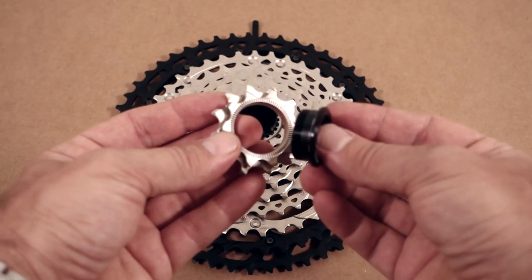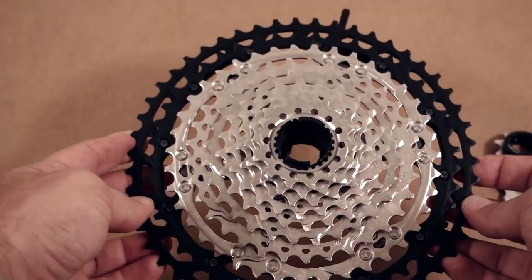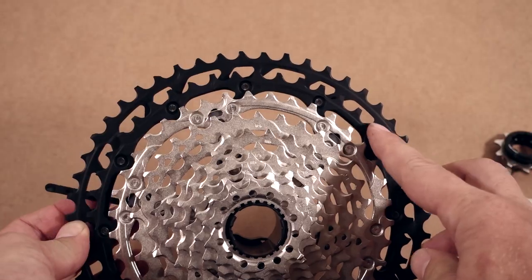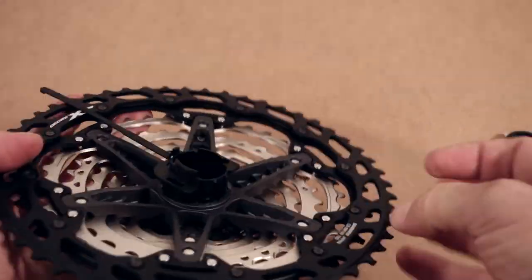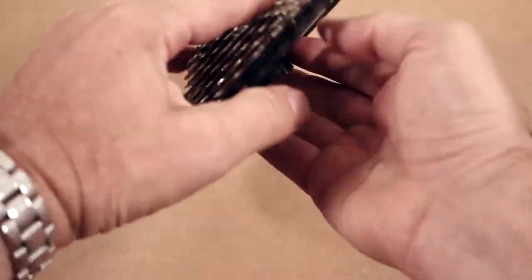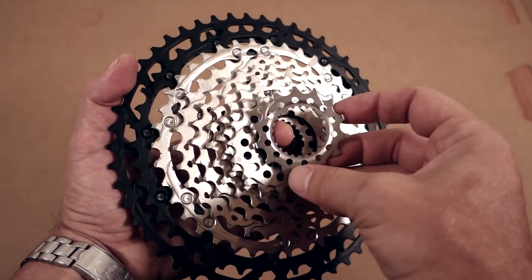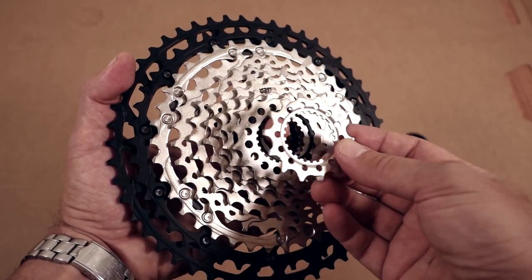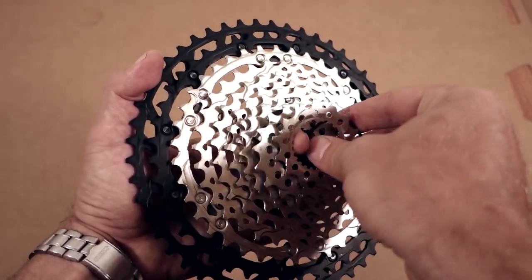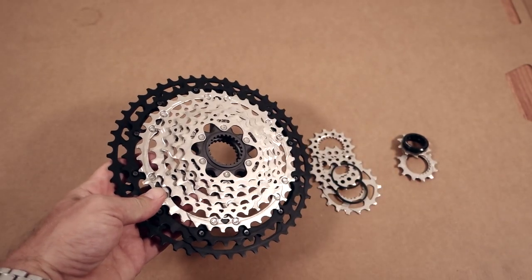The lock ring on the 12 releases the 10 and 12 tooth cogs; the rest of them are on that same tube. You can see here the two biggest cogs are made out of aluminum, just like the 11-46 XT. And if you remove this tab — just pull on it here on the back — you will be able to slide out the rest of the cogs. This new cassette design still has loose cogs, which I'm not too crazy about. You can see here the 14 tooth, that's a spacer, the 16th — that's another spacer, thicker — and finally the 18th tooth. So you have 5 loose cogs on the XT cassette and 2 spacers.